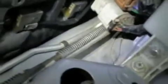Then you pull the little bolt that's holding the box and the boot. Pull that bolt out, and then you should be able to slide that whole contraption forward. Otherwise you can't get it out. You can't leave that wire on. It will not move. So bring it forward, get it out of the way, and you will definitely need the swivel and extensions, all kinds. It's crazy just to get to a dang spark plug. These ain't the good old days with the V8s with the wide open motor anymore. So those are the two hard ones.